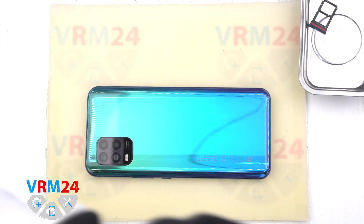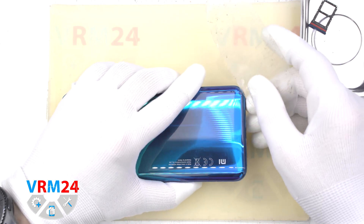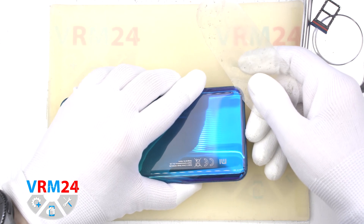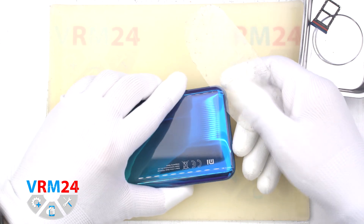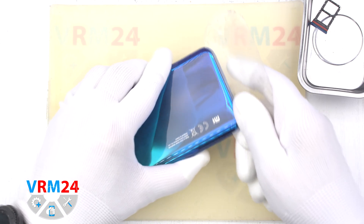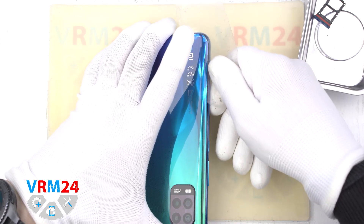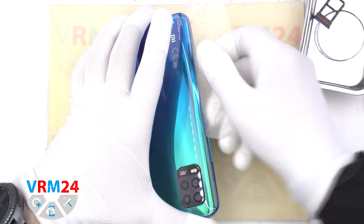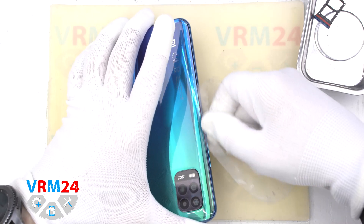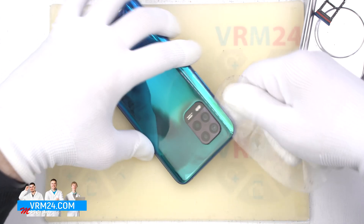We take the plastic film and pick it up. It is easiest to do on the edges. With these motions, we gently move the film along the edge. Try not to pass the film deeply so as not to damage anything inside. Under the back cover, there may be an interboard cable. We have gently gone through this circle and can open the back cover.